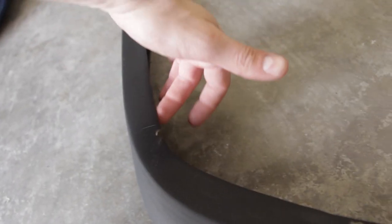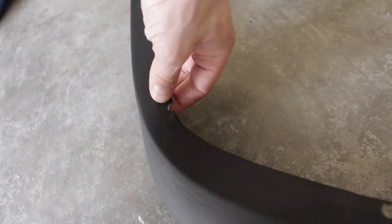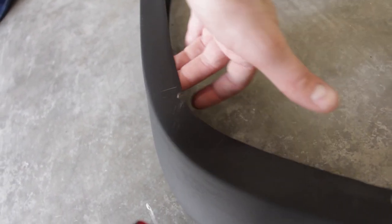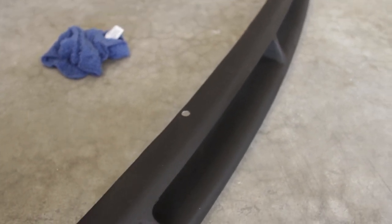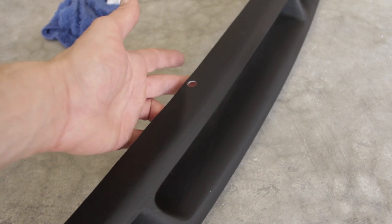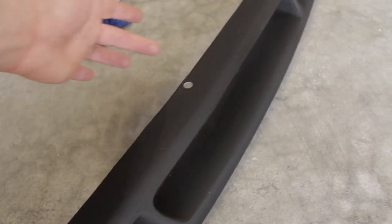It's an okay replica, it's got a few imperfections, but I think the biggest thing I'm not too thrilled about is the fact that the top of the lip is just not wide enough. You can see right there that all of my holes are really close to that backside edge, and on the sides it's actually so close that the holes are just basically divots for them to go through. The sides aren't as big a deal just because there's a plate that goes in here and bolts onto the bottom, so that's going to sandwich it, and with a plate on both sides it can't move laterally — but these are kind of an issue. So I think what I'll do eventually is pull it back off and just add some fiberglass to this and bring these out around each one of these.